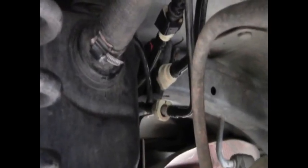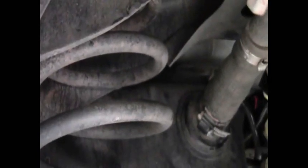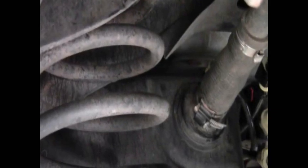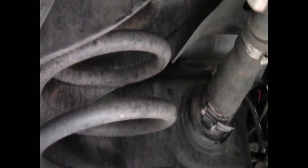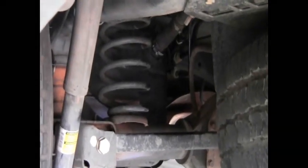I have my two clips connected at the front of the vehicle — one right there at the tank and the hard-to-show one above the transfer case. I've also connected all the connections at the back of the vehicle, and the fuel filler hose is connected. The two electrical connections on top of the tank I had to connect before lifting the tank up — those are right on top of the fuel pump. Plus there are also two hose connections on there. Make sure all those connections are made. This is the 2007 Trailblazer — some other models had different electrical connections that this one didn't have.